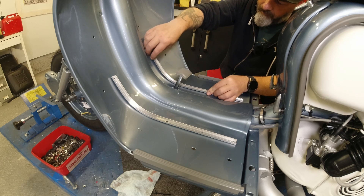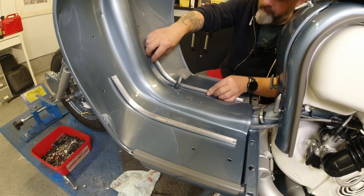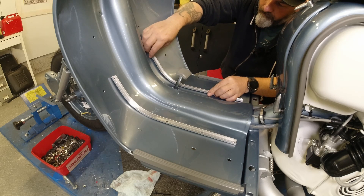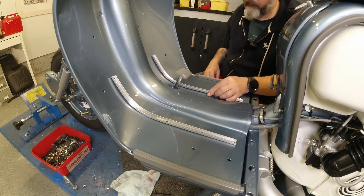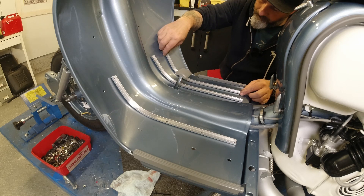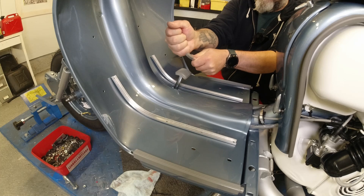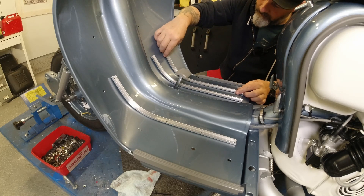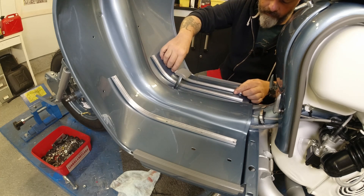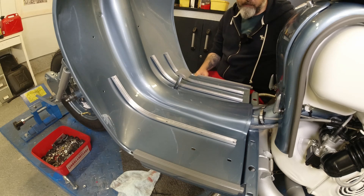There's no point rushing this — if you're doing this job it seriously takes a long time, and it's something everybody notices if you bugger it up. They'll notice it when you're riding around going to meetings and stuff like that. If you simply bolt them down so that they form themselves to the leg shields, you'll actually gouge the paintwork. See how that looks — that looks pretty good, so that's done. I'll do the same to the side ones as well.